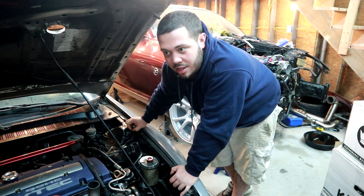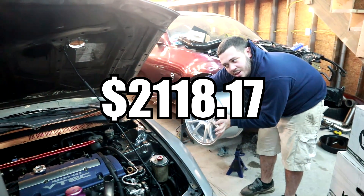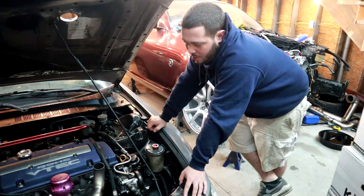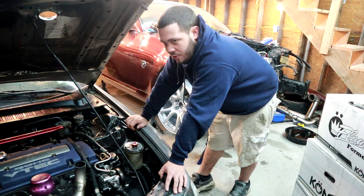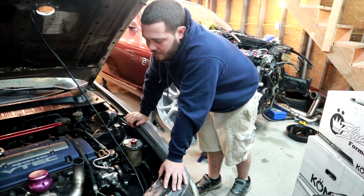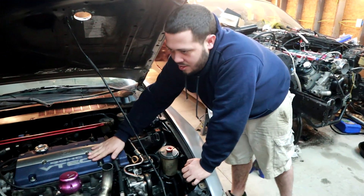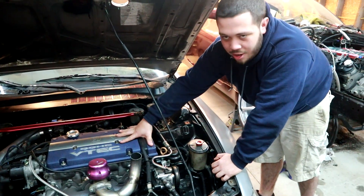So this is how much it cost to swap and boost this car. If you're doing this in a Civic you could probably B-swap it for about the same price — maybe a little less since B18s and B20s are cheaper. You could do an LS, GSR, or B20 build for very cheap. And go H-series — they just happen to fit in these cars without any modifications.